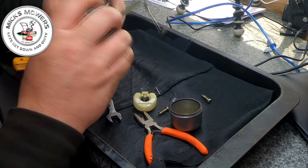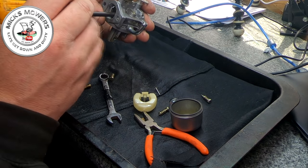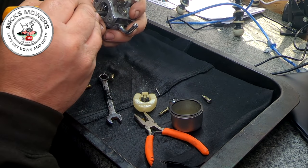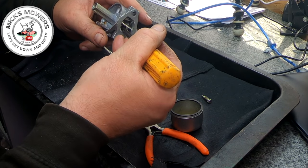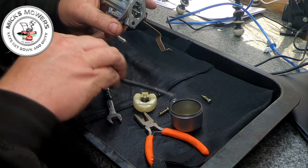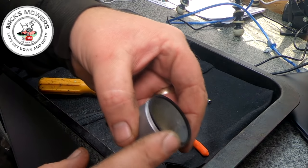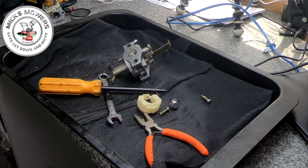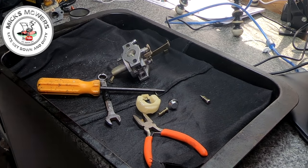You've got this one here which is your idler bolt — that can come out, generally about three threads hanging out the other side. Take that out. And you've got a slow running idle jet here — get the screwdriver in there. These are all little tiny brass jets, just go a bit careful with them. There's a little tiny jet there and that's the carby stripped right down — how quick and easy was that? You've also got a little tiny emulsion tube in there. I don't think it wants to come out, it looks like it's pressed in.